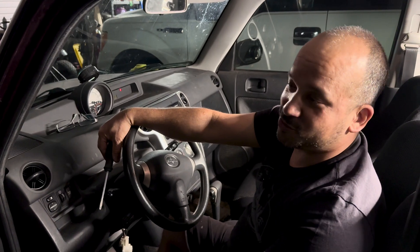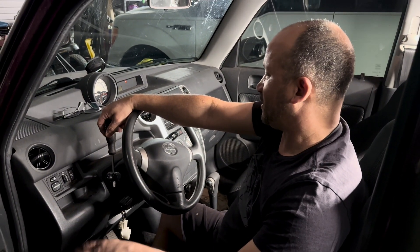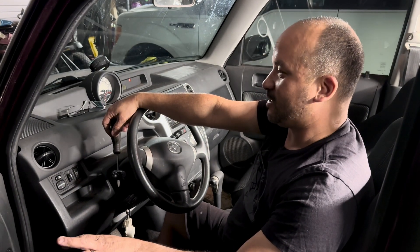I really enjoy this vehicle now. Next thing I need to do is give it a paint job — that's coming. More and more I drive this XP, the more — dare I say — I almost love it. All I've got left now is to put the seat back on, run the seat belt fasteners through it, and I'll be good to go. If you like this content, please like and subscribe and share it. What I just did here really applies to any modern vehicle — they're all going to have an in-tank fuel pump. Sorry if you don't have an access hole — you have to go underneath, which is a total pain — but Toyota on this one did get it right for the consumer. Mailman Mechanic, see you at the mailbox.